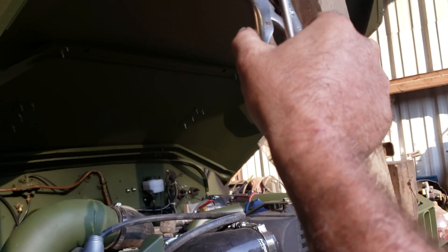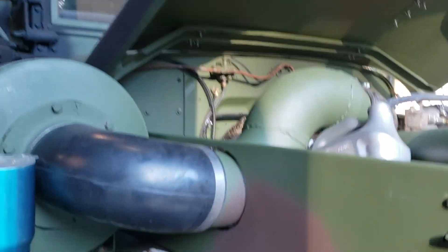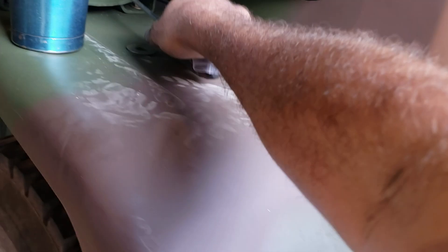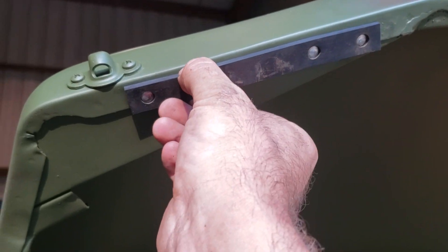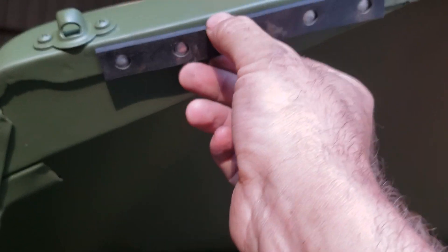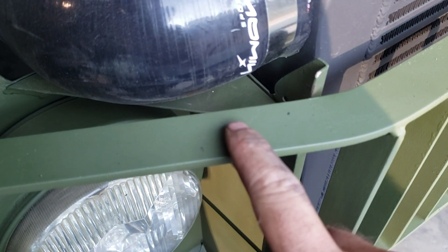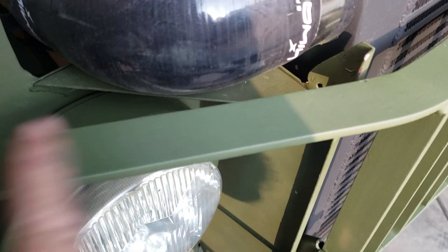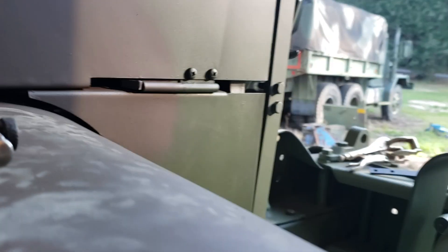You can use a small pair of vice grips on the two rivets on the inside corner, but not the outer two. You'll notice this one is absolutely tight — no wiggling, no slack. That's how it should be. You don't want it just dangling and moving, because what will happen is either the heads of the rivets will wear off on the plate, or it'll rub through the small stem inside the hole, enlarge the hole, and your pad falls off.